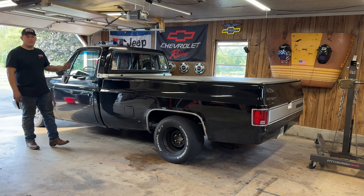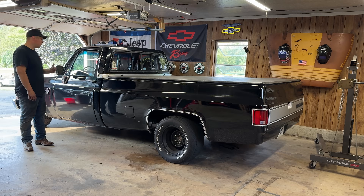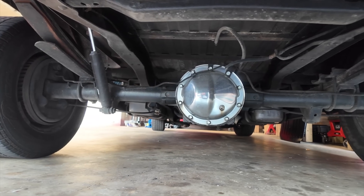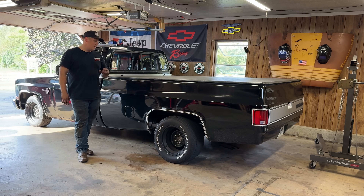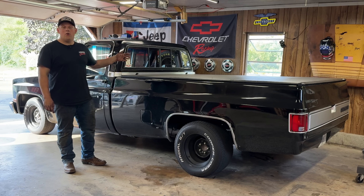It's got a good running motor — a 350 small block with a Comp Extreme Energy 268 cam and some other bolt-ons. But if we look out back, we have a 10-bolt rear, 8.5-inch ring gear that has a 2.73 rear gear set, which is ridiculously tall. Not to mention it's got open rears, so one-tire fires all the time.